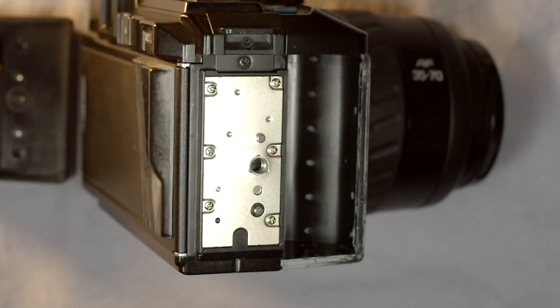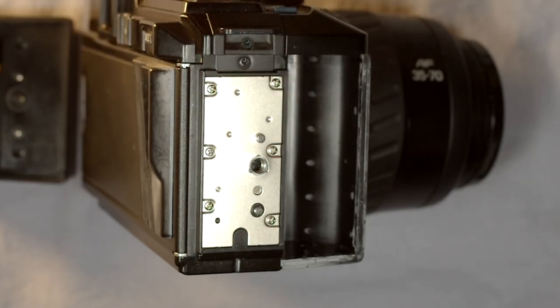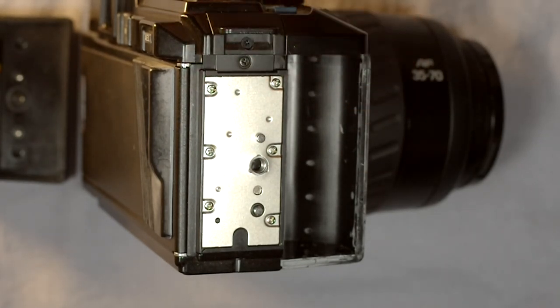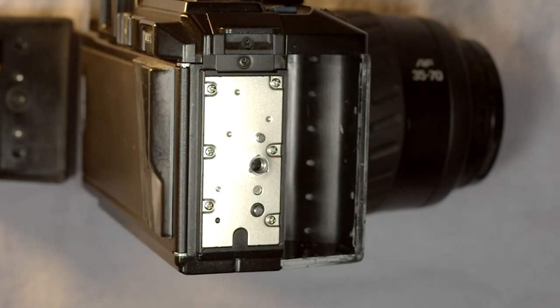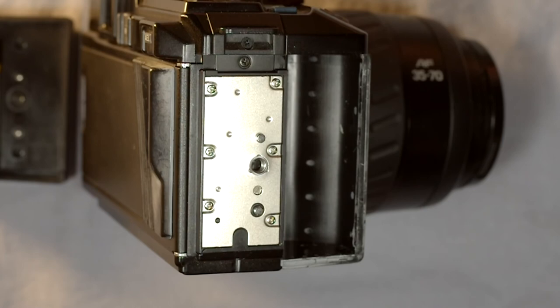There were also battery options for four AAA or four AA batteries. The stock battery door that came with this camera was the BH70L, which used four AA batteries. With the four AA battery door, using alkaline batteries you could run about 40 rolls of film. With NICAD batteries about 30, and with nice rechargeable 2450 mAh Duracells you could probably run about 40 to 45 rolls. So if you have good rechargeable AAs, the AA door is a fine option.